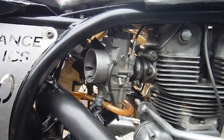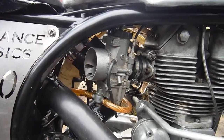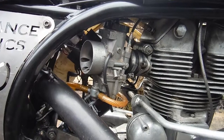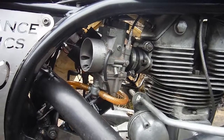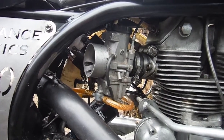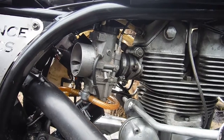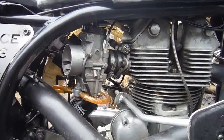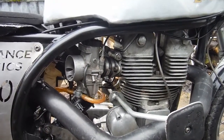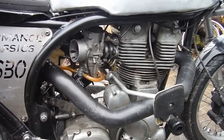We'll have to do some fine tuning and testing. We may also need to alter the ignition timing since it's still on the methanol ignition timing — we might be able to grab a little more power or smoother running from that. Those things will have to be done on the dyno. But the next move is probably to do a few miles on it just to check that everything feels about right, and then we'll go to the dyno for the final setup.